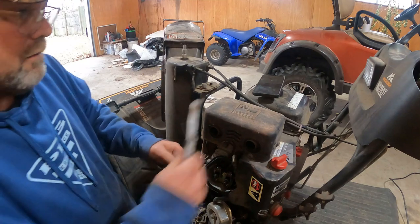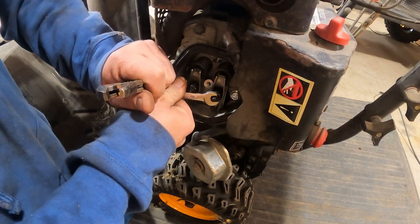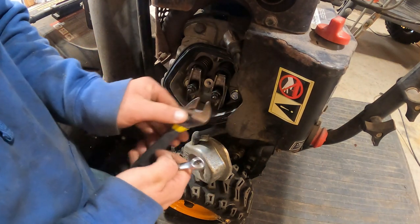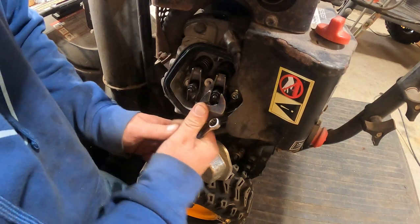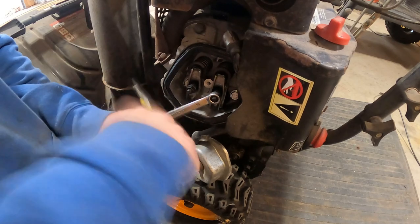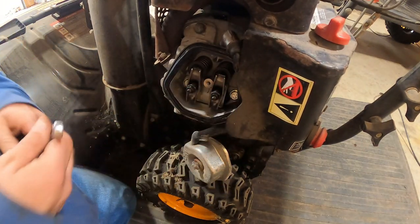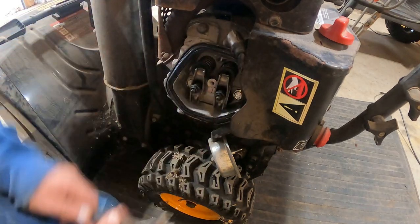Let's check the exhaust. Well, we adjust this one. We'll get this in about 6/1000ths. So we want to loosen this nut here. Oh, Lord. She's tidy. We definitely don't want to break nothing either. What is going on here? It's not popping free from that. I had to find a different wrench too. Took everything I had to break that free. I had to get a wrench and hold on to that, and popped her free, a 10 and a 13.